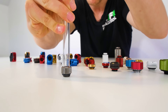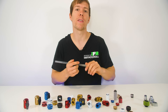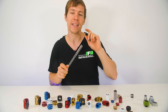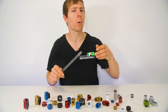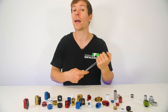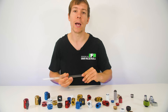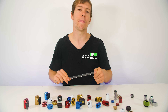Smoothing the edges makes it easier to push the tube into the fitting and creates a nice watertight seal between the o-ring and the tube. These days we have updated compression fittings — similar concept but with an added compression mechanism. The key is to buy compression fittings that match the exact outer diameter of your tube. Most common sizes are 16mm, 14mm, 13mm, and 12mm. Getting the wrong size is risky since water cooling systems build up pressure, which can cause leaks.